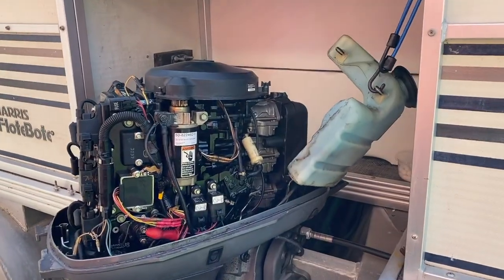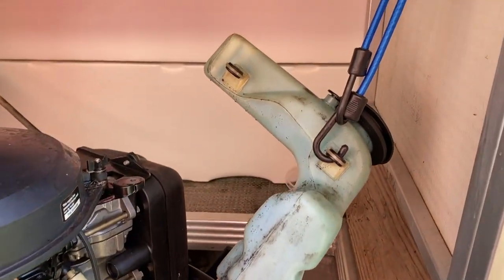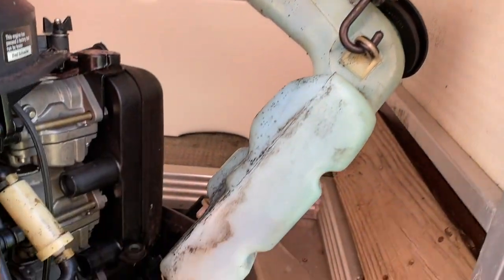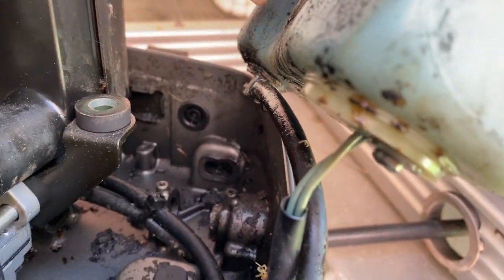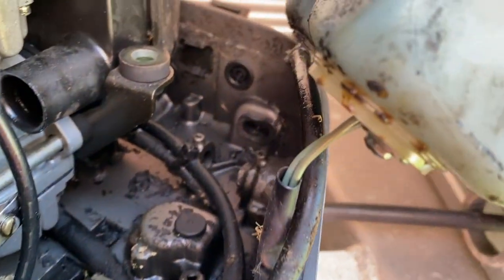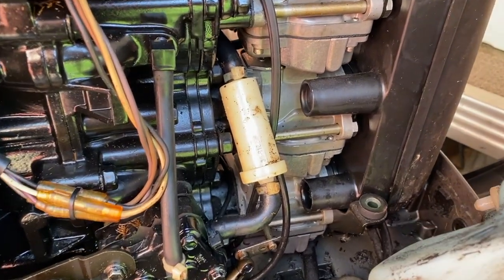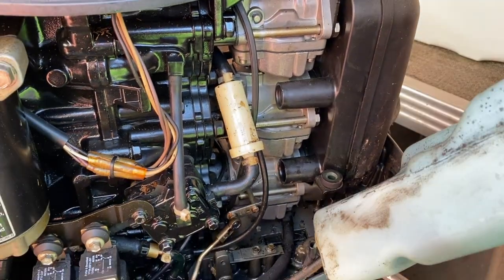Here is where we are configuration-wise at the moment. We have carefully removed the tank — not fully, but bungeed it up ever so carefully, as shown. Just be careful: on the bottom side we have an electrical sensor or connection, as well as the fitting where the oil feeds out of the tank into the hose and to the oil pump and into the engine. Don't put any strain on these fittings or connections. There is the fuel filter, and honestly it looks like it's got some age on it, so replacing it is a good idea.